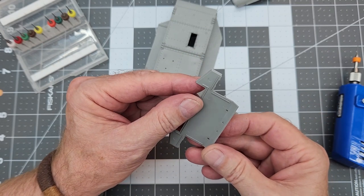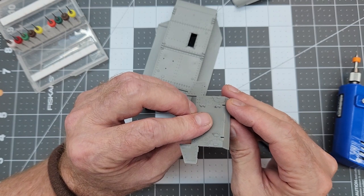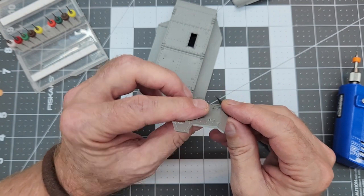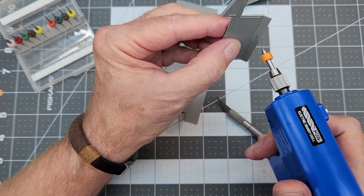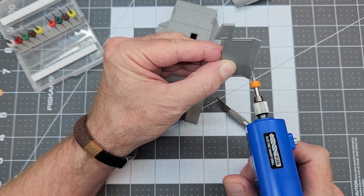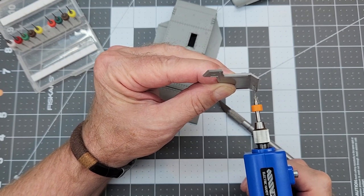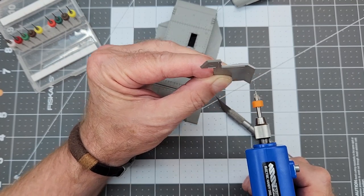For our towing pintle going on the very back, the bracket has two alignment holes in the bottom of the plate. We're going to drill those holes through. The locator is kind of like a little half-moon slot — just get your drill bit down in the bottom of that slot and drill it straight out the back. That's all you've got to do.